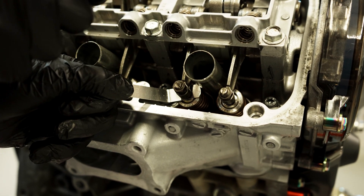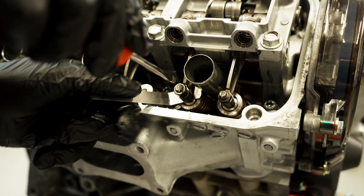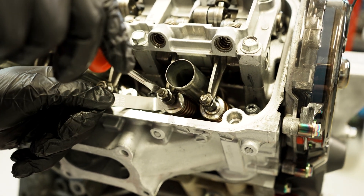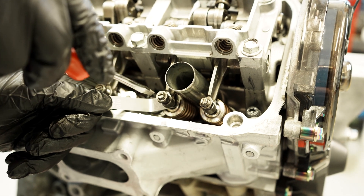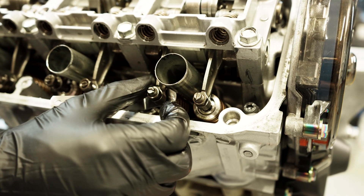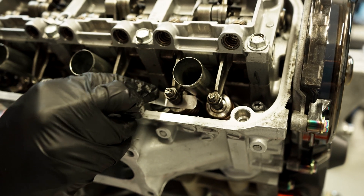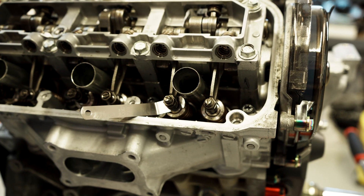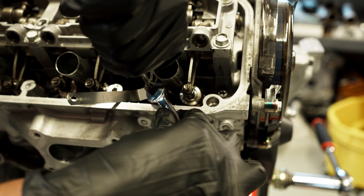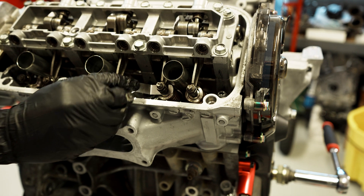Go ahead and turn the screw in and feel how the feeler gauge feels as we're tightening this up. Remember, we want a slight amount of drag — we don't want too much. Another good note: go ahead and get oil on all of the rockers, make sure they're nice and lubricated. This helps your feeler gauge slide in and out better. Honda also recommends that you have oil on the adjustment screw and the nuts when you're going ahead to tighten these up. So that feels pretty good to me. I'm going to use the 10 and just give it a little snug.